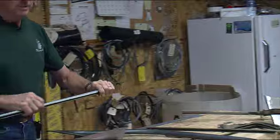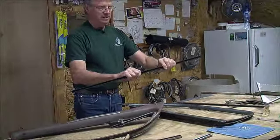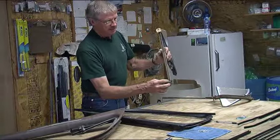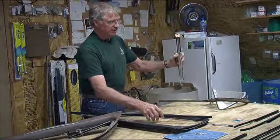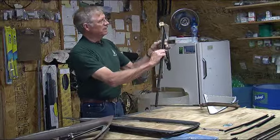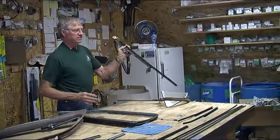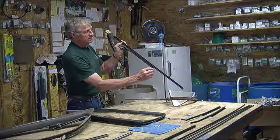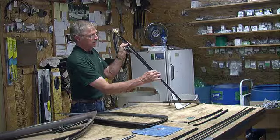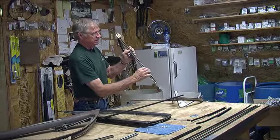Whereas on your '49 and your '50, this is not a rigid channel — it is bendable — but you merely lift this out and then put this channel in its place. One way to tell if it's a '50 or '51 — customers ask me this — is easy: the '50 does not have the stainless bead on the channel. The car channel itself makes up for the stainless edge.